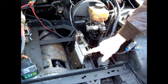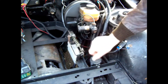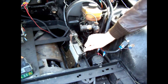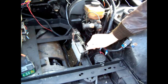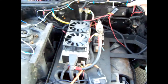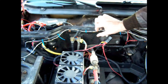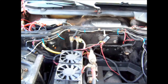That's the variable pot — the brightness knob on the dimmer, if you will. There's a micro switch that clicks first to say that the pedal is being moved, and then the motor starts to turn at its minimal speed. And then beyond that, you'll see when I turn the key and step on it, you'll see this move. So that's the 1000 amp controller, and this little block on the wall is the shunt for the battery management system that shows you how many amps you're drawing from the main battery bank.